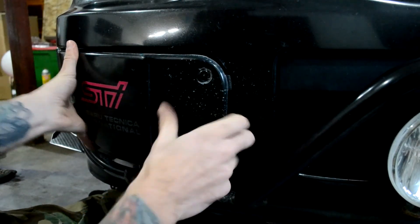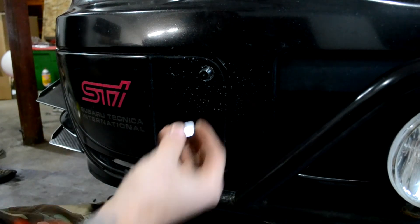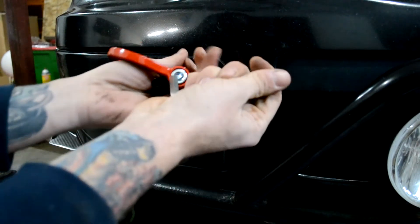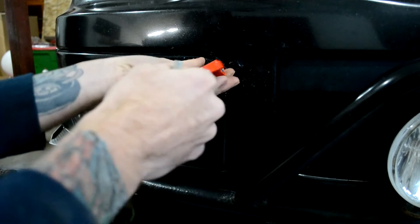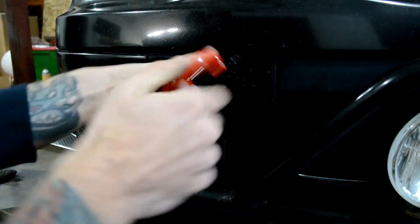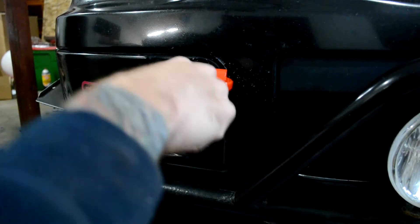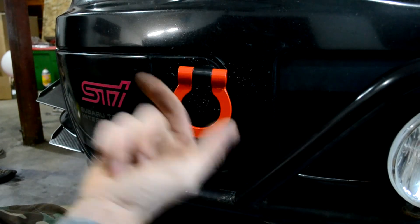This is kind of a little tricky to do — it just takes a little bit of manipulation. And she's in there. As far as your nut, put that on there. That nut is just for backing up against the tow hook once you actually get it installed. They give you this Allen key for this guy, just to kind of loosen it so you'll be able to work with it a little bit more. Thread this piece on here. Once you've got that all the way tightened and orientated the way you want it, you can tighten this up — just be sure to carry this so if you do need it, you're able to move it and pull on it. If not, it'll just kind of flap around on you. Get that where you want it, then tighten the nut back against the actual hook itself.